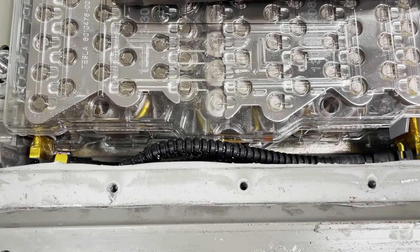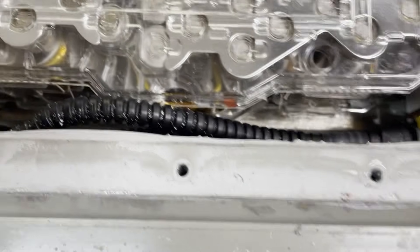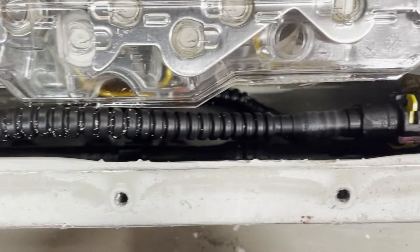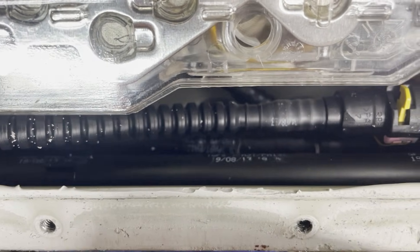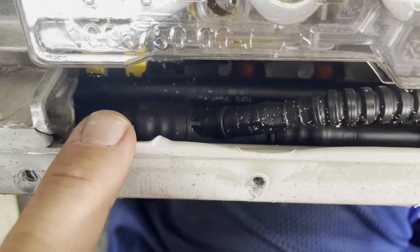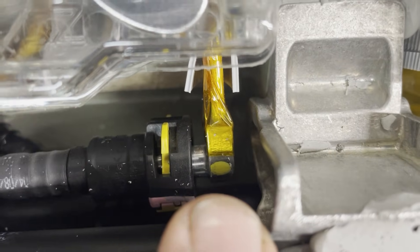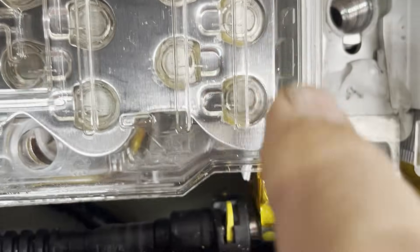On the opposite edge, towards the center of the pack, we have the electrical connections and the BMS. But on the outside of the pack we have the coolant connections — these black corrugated plastic hoses. Looking back in there, we can see more of the coolant line connecting everything together, teeing off like this. That part wrapped in Kapton tape is the coolant line — it's a flat tube that wiggles its way through the pack.